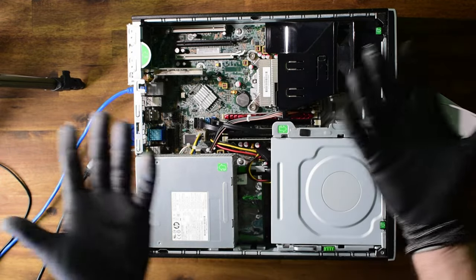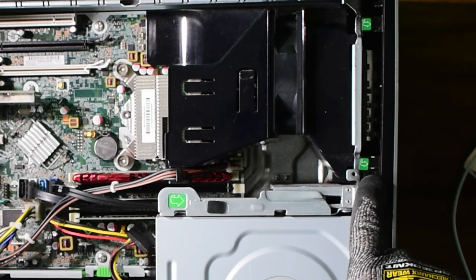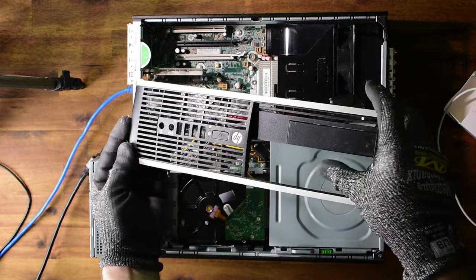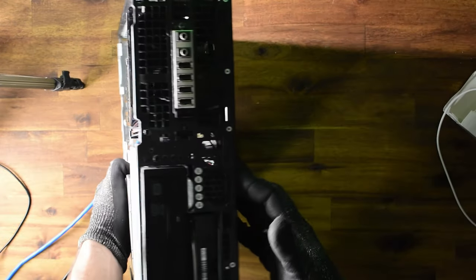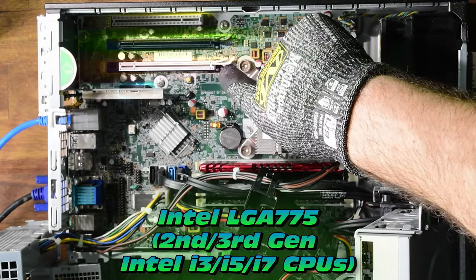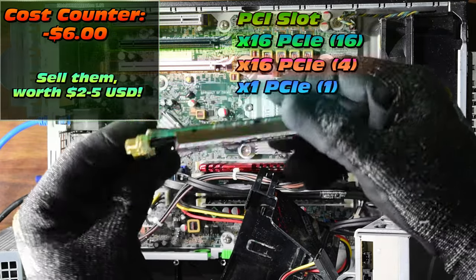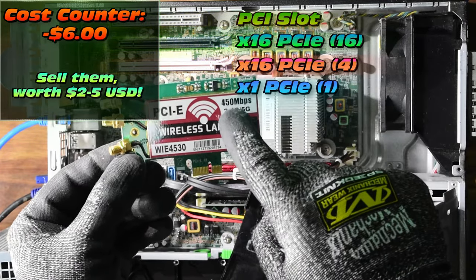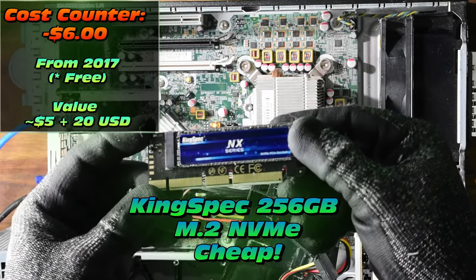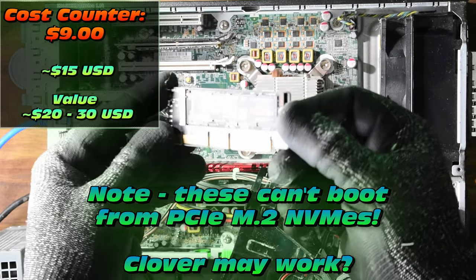All we need to do is take the small hard drives we have lying around. The real magic here is the front I/O expansion — this particular machine has a very nice 3.5-inch bay and even a 5.25-inch bay. Looking at the CPU area, there's a nice little cooler with some shrouding and three PCI slots — not quite sure on the lane expandability. We also have a Wi-Fi card, which is always a bonus.